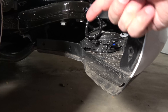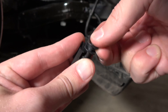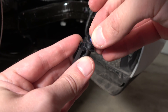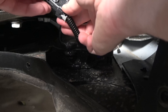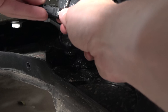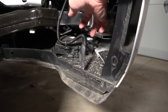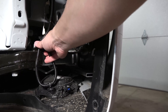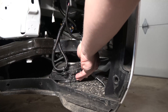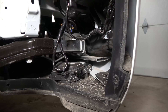And for the male speaker wire, we have this female port right here. Same thing on the opposite end — we're going to put these little plugs in, make sure it stays nice and watertight. It does only go in one way, but it'll snap together with a pretty satisfying snap. We'll go ahead and lock that gray pin right there — now that's locked, all waterproofed up with those little plugs. We could just leave this dangling here, but instead we're going to take some electrical tape and tape it back to itself. A little extra electrical tape never hurt anything. Make sure everything's nice and snug, not going to get any rattles, everything is still connected where it needs to be. And that's it — we're good to put it all back together and test it.